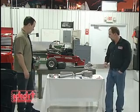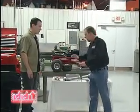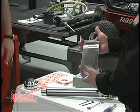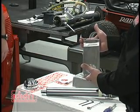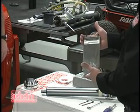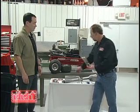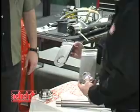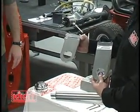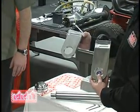One of the first things he's going to need is a mount to hold the column into the vehicle. And this is a 7.5-inch drop. This will go to the dashboard, or in this case it's a fiberglass bodied vehicle, and it'll go to a structural beam that's up underneath the dash to mount the column to. If this were a steel dash, then we would use a drop that is contoured specifically for that dash. It's cut at an angle so it matches the angle on the column.